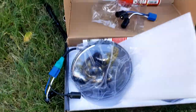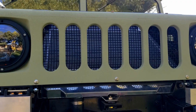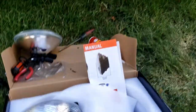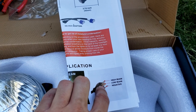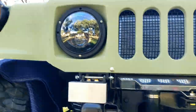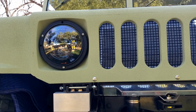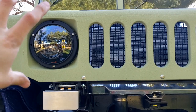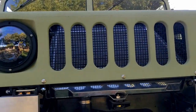I got the new headlights on and they didn't actually require any modification — they just slipped right into place. I followed the directions, looked at the plug to identify high beam, low beam, and negative, then just looked at the numbers, plugged them in, and put the face back on. I haven't turned them on to do all the adjustments yet, so I may have to adjust up or down or left or right, but I'll need to do that a little bit later.